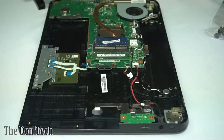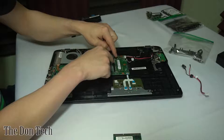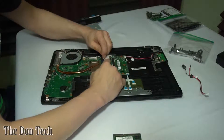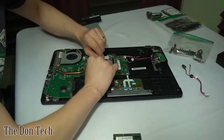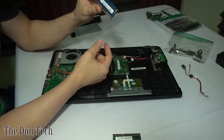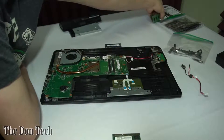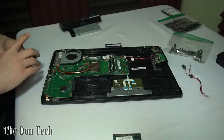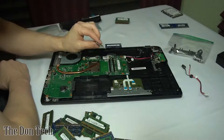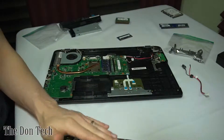Next up, if you want to learn how to upgrade the memory in this as well — you have two different memory modules. It comes with six gigs: a four gig module and a two gig module. I'm going to take that two gig out. It's going to be DDR3 low voltage, so I need to make sure that when I replace it, I put another low voltage stick in there. Here's another stick — this is four gigs, low voltage, 12800. Usually you want to install them equally. So now this machine will have eight gigs of DDR3 RAM.